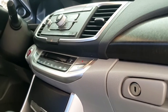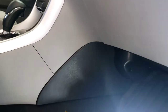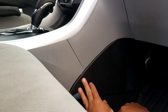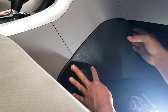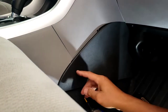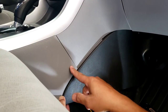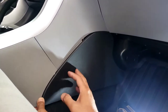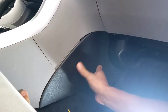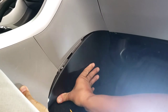Here's the radio. You don't want to take the whole radio off — you just want to take this black panel off right here, and here's how you're going to do it. I'm going to pry it off right here — pull this out first. I pre-pried it already. Pry like this right here, and then right there: there's two clips, one right here and one right there, and there's a screw right there. You just kind of push this back in a little bit and pry it out like this. Try not to break it.